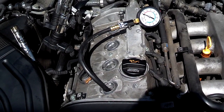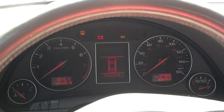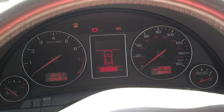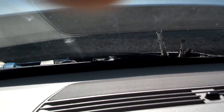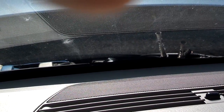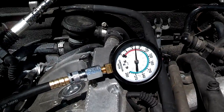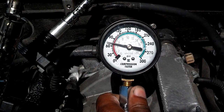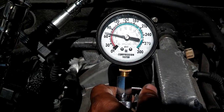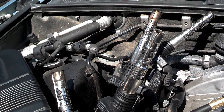I screwed the compression gauge down into — I believe number one is up front. I'm going to go ahead and crank it, listen to it crank eight times, and come out here and read the pressure. I actually stopped cranking because when I looked at the motor, I saw liquid splashing out over the motor — I thought it was fuel, but it turned out it was coolant. So I'm going to go ahead and crank it a few more times. The first reading on the first cylinder — the highest it got was 70 PSI. These compression gauges, when they get to their highest point, they'll hold that pressure. So I'm going to bleed it off and check the other cylinders. I can see where coolant sprayed out onto things that I have unplugged.